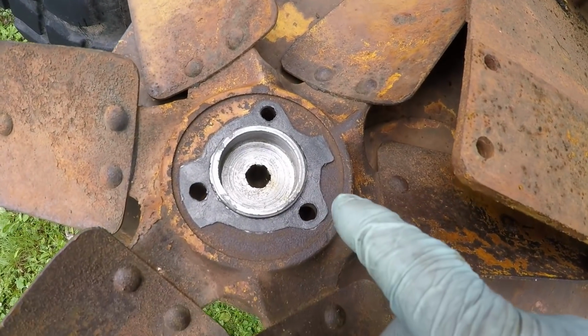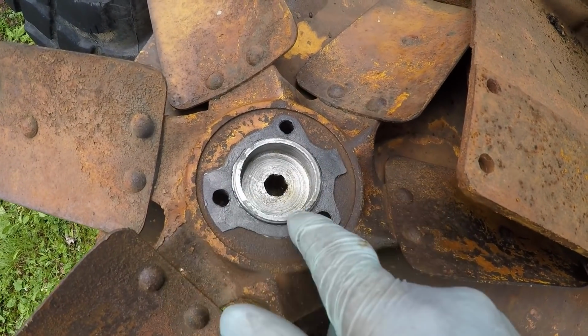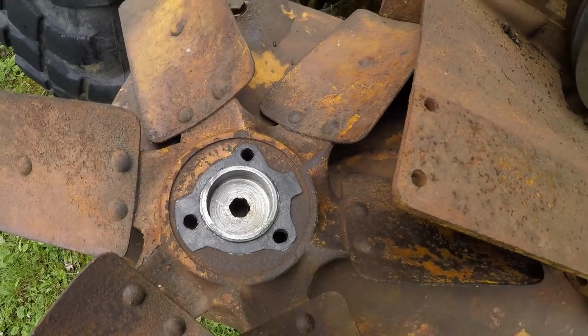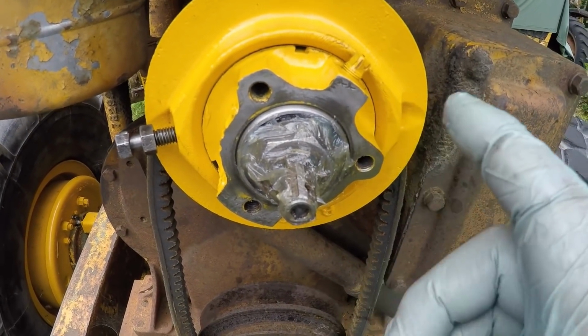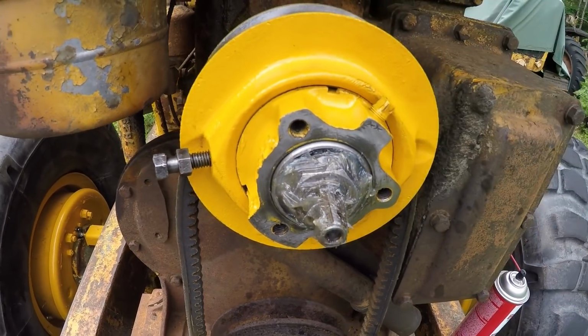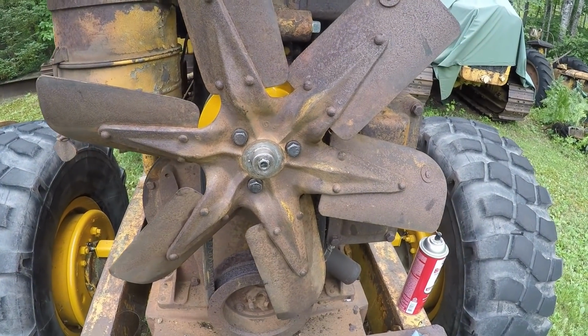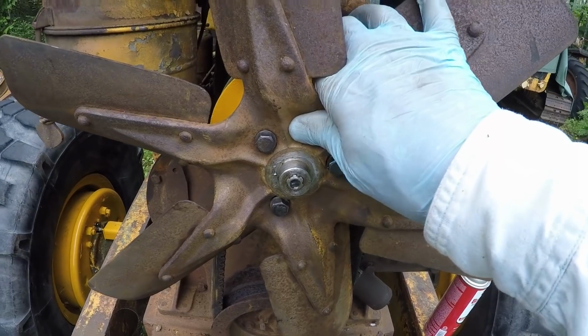As you can see, I've got the gasket installed, got sealer on both sides, but the fan does have this extended collar on it that will press on the outside of the bearing. When this is all fastened down, that will take care of this play. Okay, fan's installed. As you can notice, it took all that in and out play out of there.